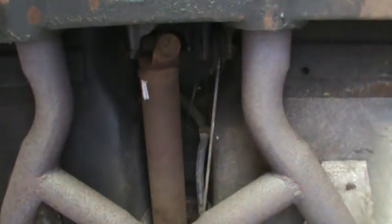What we have is basically a little over 3 revolutions, which tells me that this is probably a 3.08 rear end in this car.